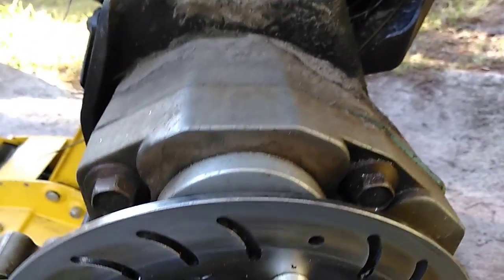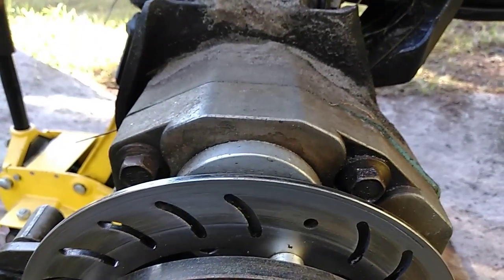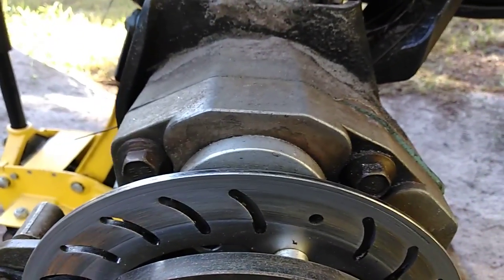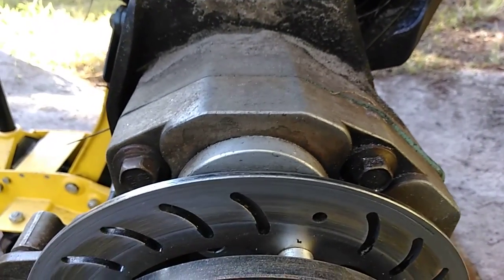Still not a huge deal. It's a really slow leak, right? Well, oil can leak out. What can get in? You're running the portal on the trail, it's a little warm, hits cold water, contracts, there's no vent, so it'll pull water through the bolt hole into the box. I change my oil every ride because this is a $3,000 investment, and I like changing oil, it's my thing. But if you let that water sit in there, you're going to toast your portals.